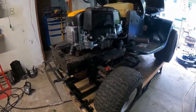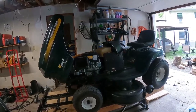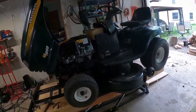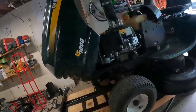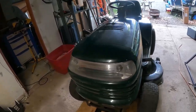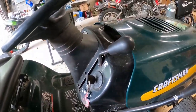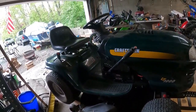That is a lot quieter. There's definitely some dirt and rust in that muffler — it is smoking. I completely forgot to hit start on my time lapse. Cutting deck is back on — a little bit of a hassle, but there are a billion videos on YouTube on how to do that. Hood's back on, exhaust is okay. I haven't built the bracket yet. I ended up going to the hardware store and found a spring that fit — it works exactly as designed. It's a little tougher now, but goes in and right back out, so no need to reach down there anymore.